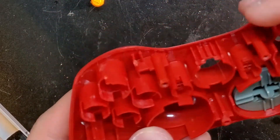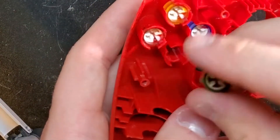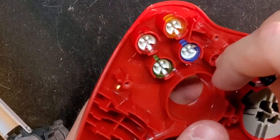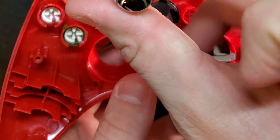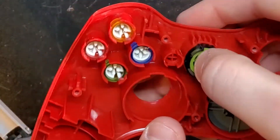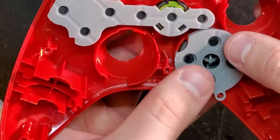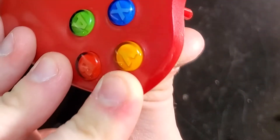Set this in — those are good. Y is at the top, B is at one of the sides. It's weird looking at a controller inverted. Let me double check — oh! So we need X, A, and the center button. Once we get this down, we can put the little rubber button pads over top. Like I said, I'm going to use the parts controller one instead of the worn one. Those go there, and look at that — it looks really good. It's not perfect, but it's definitely better than what it was.